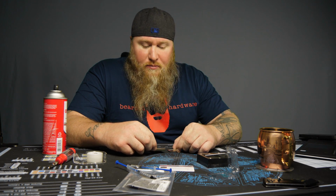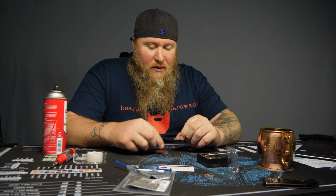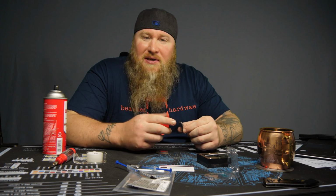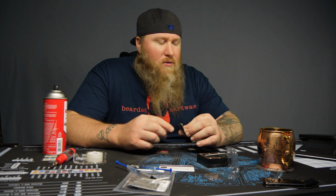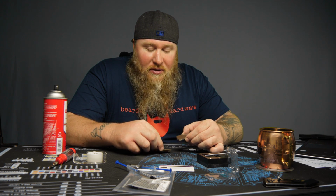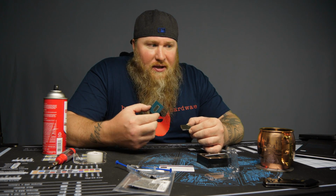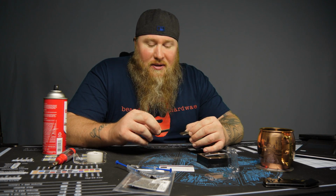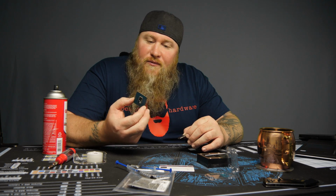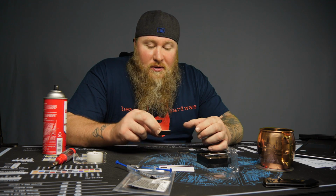So, Slackers, you can pretty much see, look at that. You see the beard off that. Looks pretty damn cool. I didn't go too crazy on the IHS. I'm going to use a direct die, but I want to see what the temperature difference is, how much is improved. I'm guessing it's going to be quite a bit, because I didn't really see or hear much of a pop. Usually I hear a really loud pop, and this one was barely anything. I had some assumptions, maybe the solder was just overheated or something, where it just doesn't do good. So I guess next thing to do is throw it in the machine and then compare temps to how it was before. So let's look at that.